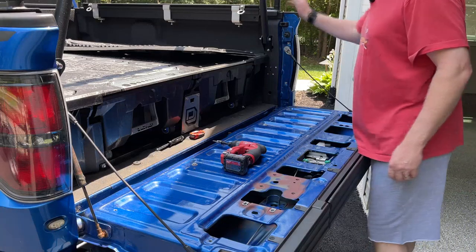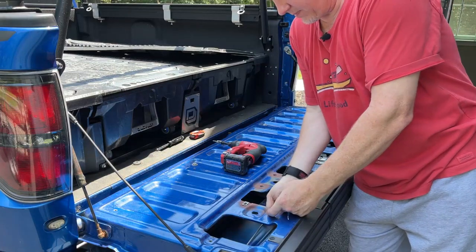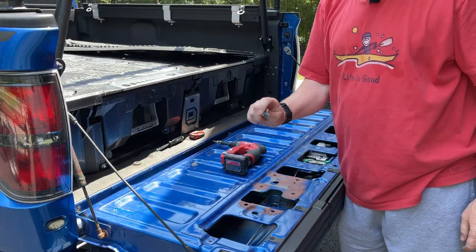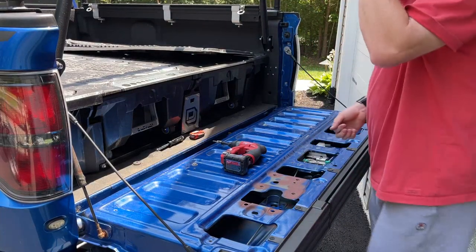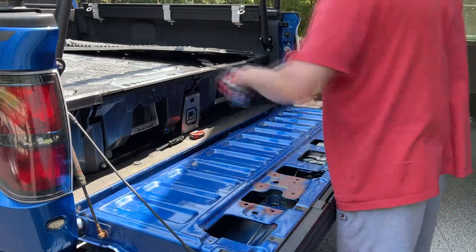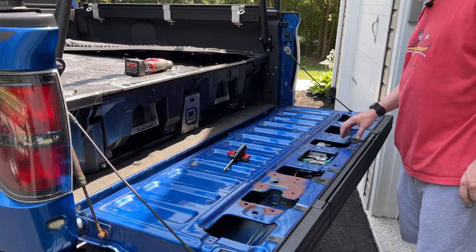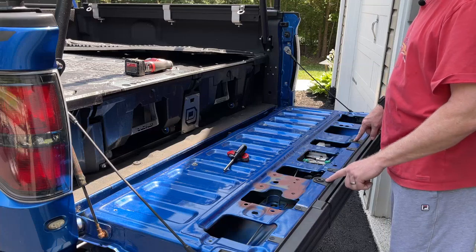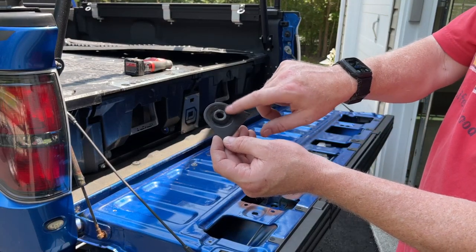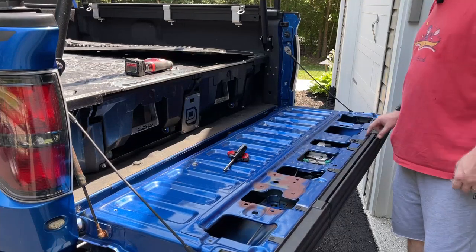Part of the reason I don't need a pole is I have the rack on the top of my truck and I can use those poles to jump up. Once you have that out, pop off these nuts — these slide-on nuts, for lack of a better term. Now I hit this up with primer and since I put it back on it's a little scratched up. This piece of plastic up here has these nubs that go on. You have to take these off in order for the new piece of metal to fit in because it won't fit down. You could grind all that out if you wanted to, or you can just cut them off. You still have the two locations that hold this piece on, so I just cut these off.